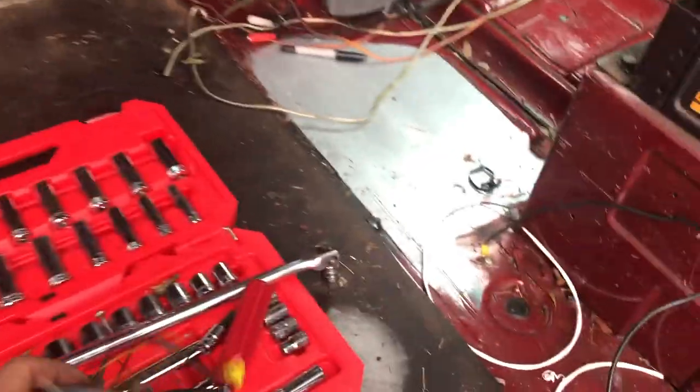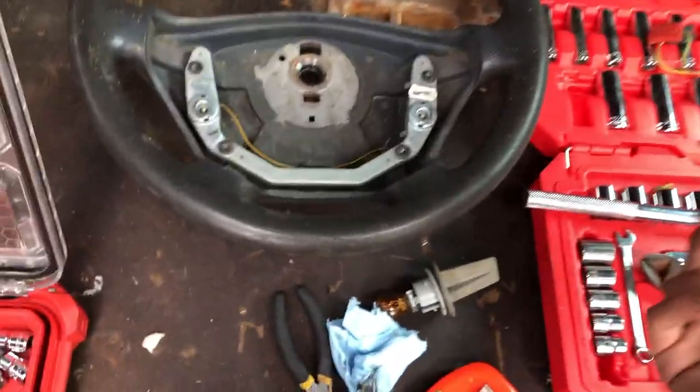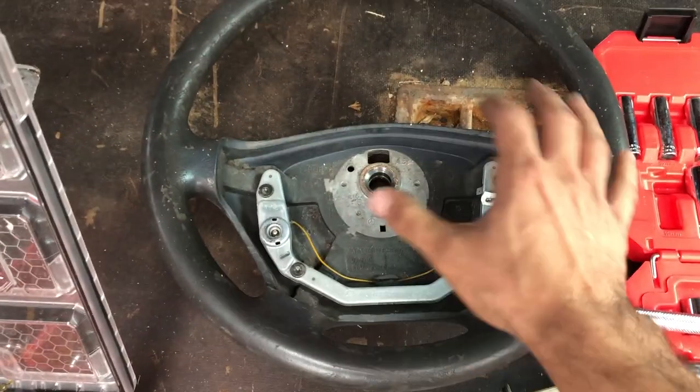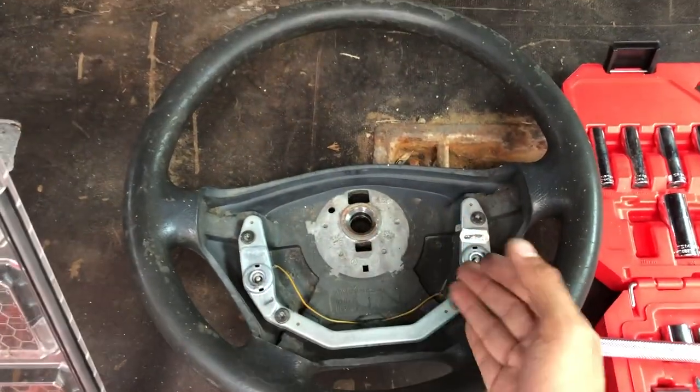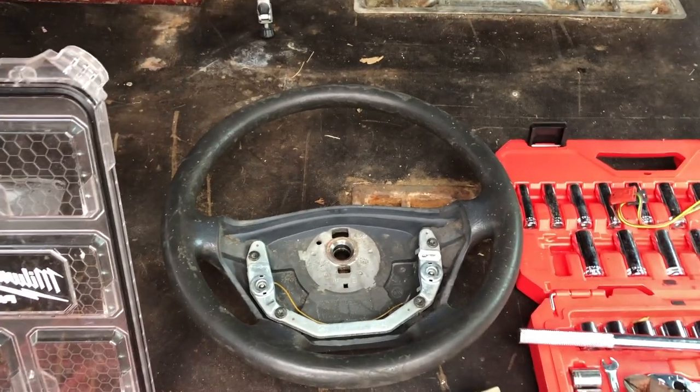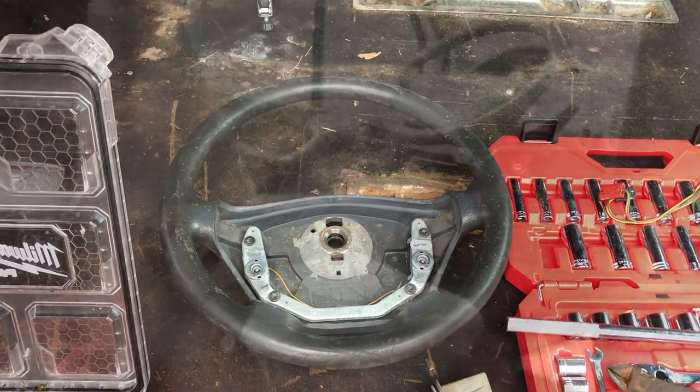You are going to have to tear apart your steering column area quite a bit though. So the clock spring directly delivers power through these pins into the steering wheel. My horn currently doesn't work and by extension I have an SRS light that is always on — something inside my clock spring is damaged and we're about to find out what it is.